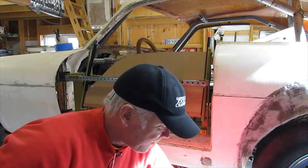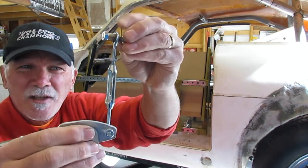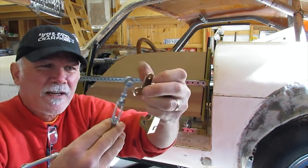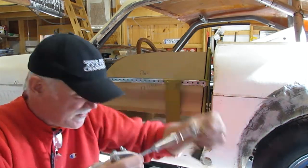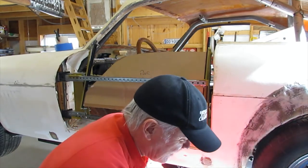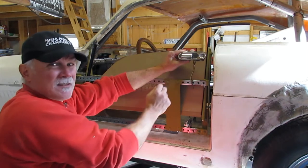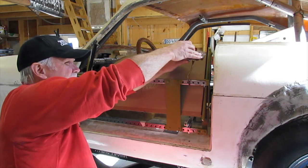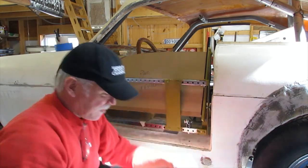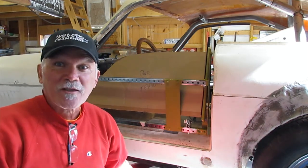I have another one from the other side. What I'm using is these turnbuckles as adjustable links — to connect on one side the latch bell crank to the bottom bell crank, and on the outside to connect the other side to the door latch bell crank. That door latch is going to sit approximately right here. As I pull up on this, it will pull this rod up, that rod will pull this up, the other side will pull down, pulling down on the latch — and that will open the door. What could possibly go wrong?